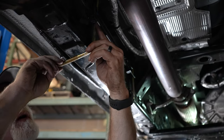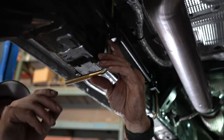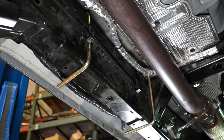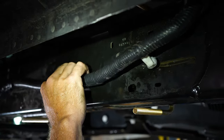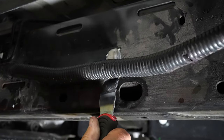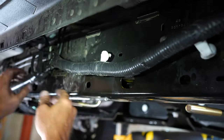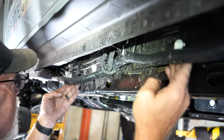You're going to pre-hang the U-bolts up here and then you can slide them back and forth on the frame itself — just pre-hang them. That way you don't have to fight them when you get them back up there. We're going to do that both sides. We're going to pop this wire loom loose from the frame. Our slider foot has to come in and fit underneath of it. It's just a pop tool — pop these plastic rivets out and just loosen up your wire loom from the frame.